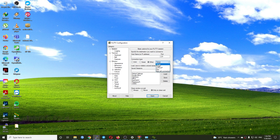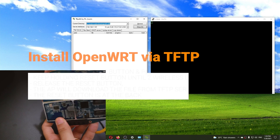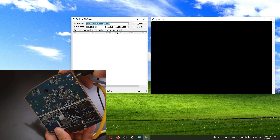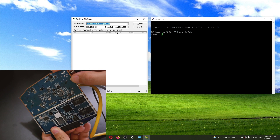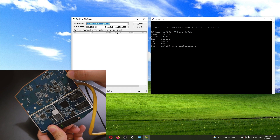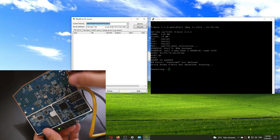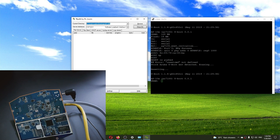As you can see from Device Manager, the console interface is COM4. Let's input the same on the PuTTY application. When everything is ready, we need to press and hold the reset button while plugging in the power cable. Continue to hold it until both wireless LEDs on the right side of the AP blink red. At this point, the AP will automatically download the firmware from the TFTP server and install OpenWRT. It takes around 5 minutes to complete. If you don't have a console cable, please wait 10 minutes and everything should be ready by then.